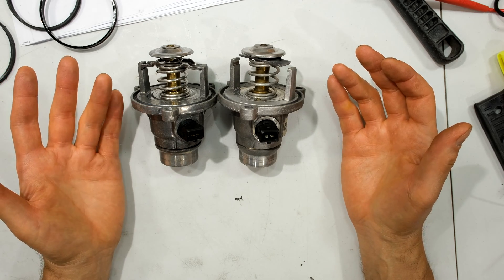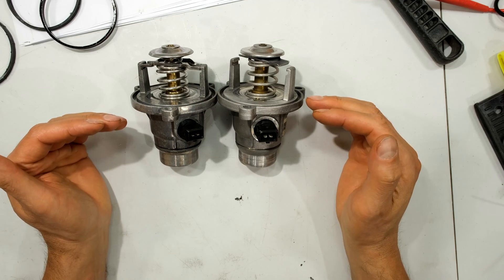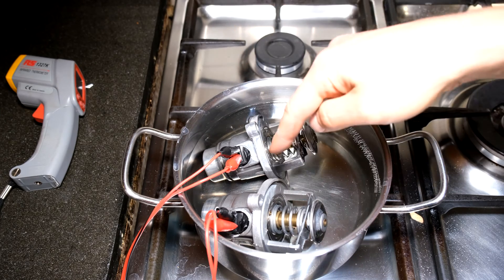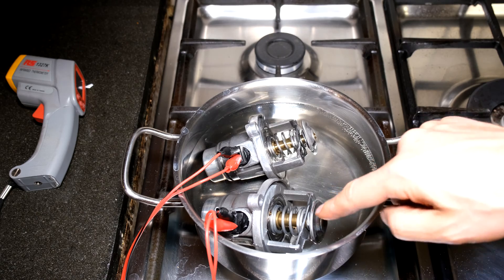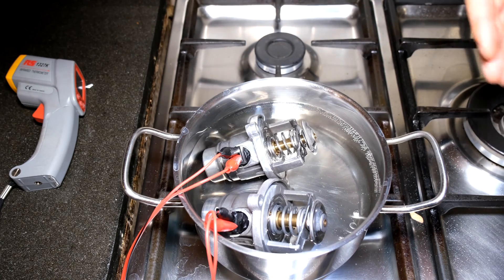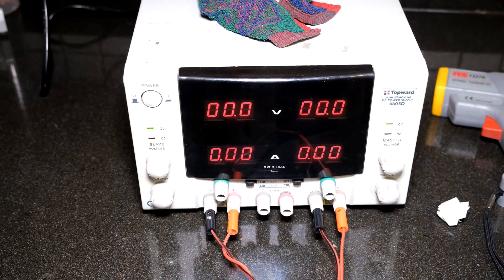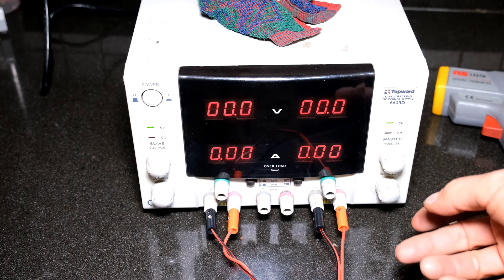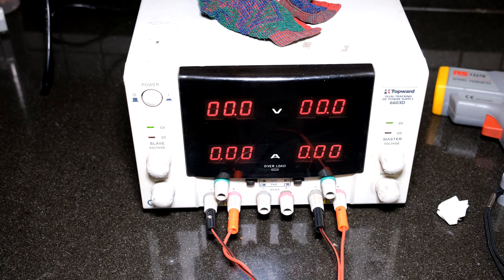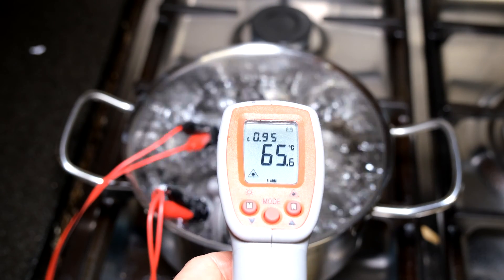I also boiled them and tested them by adding current, and they opened exactly the same — I couldn't find any difference. So this is the generic one I'm modifying, and this is the original. I've added a voltage and current source to try and initiate opening earlier, because I can't get the water temperature in this pot above about 80 degrees. Here is my bench supply — I'm going to set the voltage at 12 volts and current-limit it. For now I'll just boil it without adding the supply.